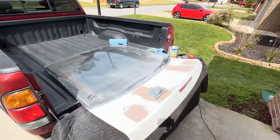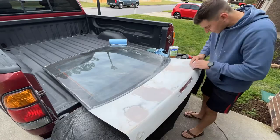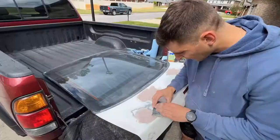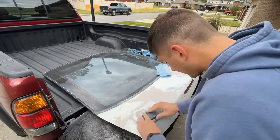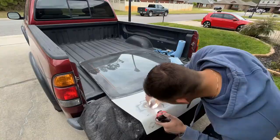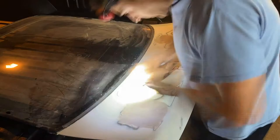After the Bondo was good to go, I started on the sanding spree. I used 80 grit to knock down the Bondo quickly, and then switched to 120 once I felt like we were getting a little more close to smooth. You can see the crosshatch pattern that I'm using, alternating the direction I'm pushing every once in a while. I probably should have been covering bigger areas, but in my mind these are such concentrated high spots that it kind of made sense to focus most of my time there and then worry about any waviness once they were a little closer to the original paint. I just picked up this rubber sanding block from Harbor Freight, and it was working well for me to keep consistent pressure across a bigger area — but I think if I was doing a more curvy panel like a fender or quarter panel, I definitely would have invested in a longer sanding block to try and get more fluid results.